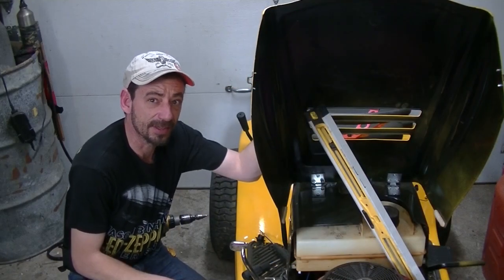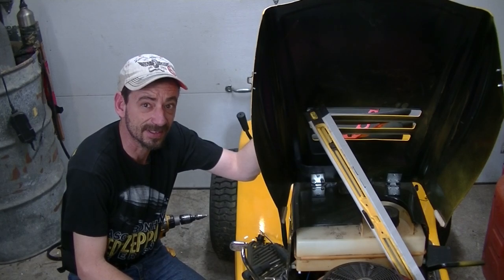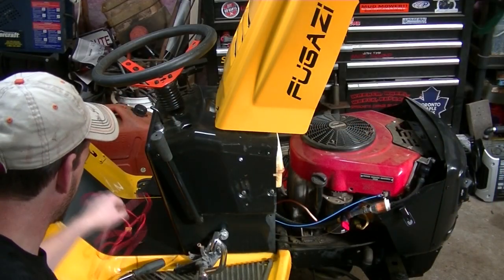Saying, but I'm going to point it out anyways. Whenever you're doing any kind of electrical installation or modification on any vehicle, disconnect the negative cable from the battery before proceeding. Always. I think what I'm going to start doing for starters is preparing the switch to go in.